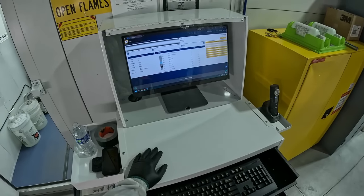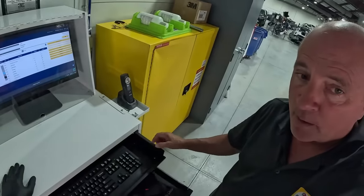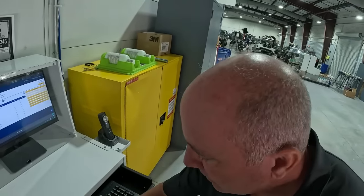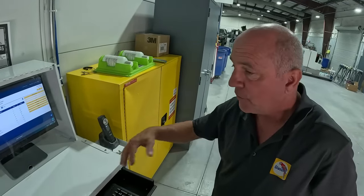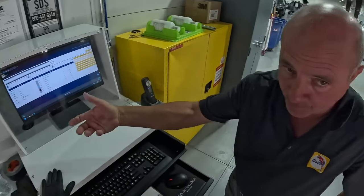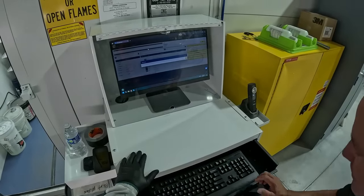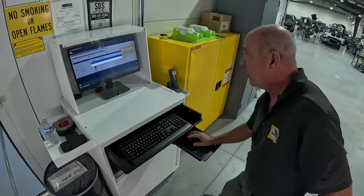Now you're just going to see it. How many ounces do you want? We're going to need about 24 ounces, I would think. I would do 26. I'm used to mixing 24 and then it hits 30. Okay. We're only putting one coat in a drop, so I don't know. Right, you're doing the back side of the hood, front side of the hood. I would mix as much, doing a fender, a full cup. A full bumper, I'd probably mix 28. I don't want to be out of it. I know there's a lot to do with putting it all on and having the paint ready with this system, isn't there? Yeah, you don't want to run out of color.